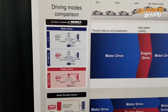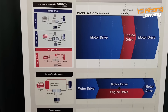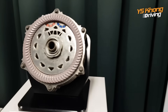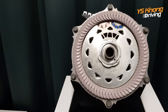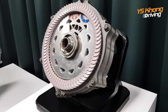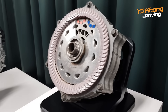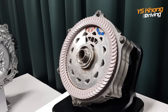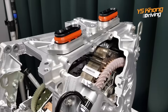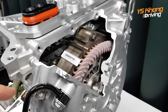So is this a new system? Yes. This is the latest iteration of the hybrid system. Now we're going to take a look at the coil motor — this is what your motor looks like. The motor remains the same thickness. How much power it generates depends on how much current you put in. You give it 267 newton meters of torque, it will deliver 267 newton meters of torque — it's the amount of electricity you supply. The other component is the generator, which generates current for the batteries and to drive the car.